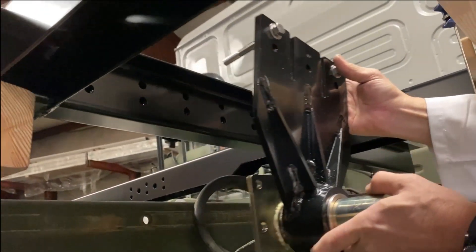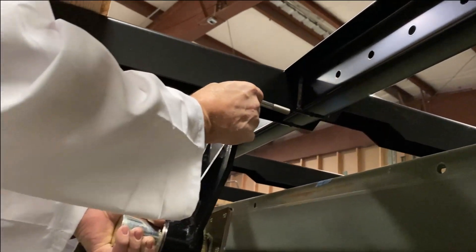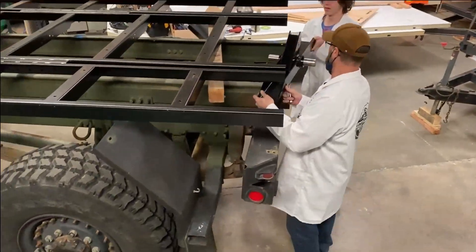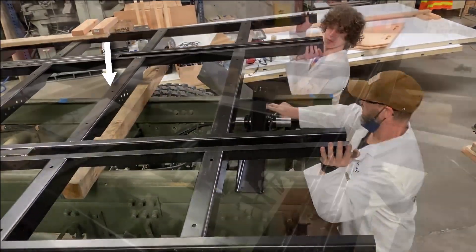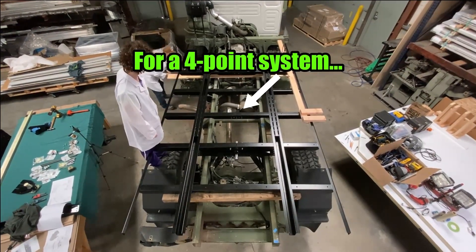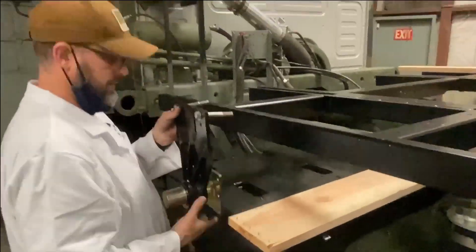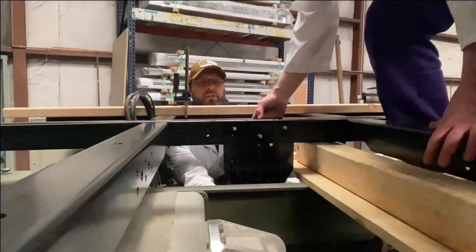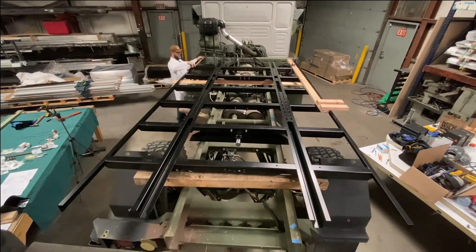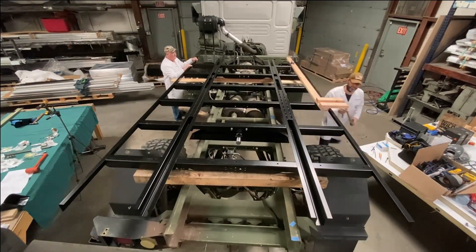This will clear any kind of subframe connectors or brackets you might have. If you opt for the four-point, you can move the bracket to the center and have almost a full 24 inches of adjustment based on the center of the other pivots. For three-point systems, position the rear pivot mount one cross member forward of the rearmost subframe cross member, aligned with the pre-drilled holes in the frame. For the four-point system, position the pivot on the longitudinal center cross member of the subframe. Temporarily and loosely bolt the bracketry to the subframe, aligned with the pre-drilled holes in the frame. Confirm the positioning of the subframe on the truck both lengthwise and side to side, reconfirming after any adjustment.